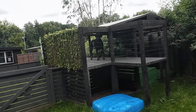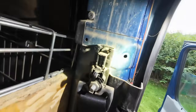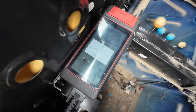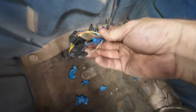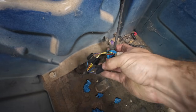Pretty glad there's a cage in the way! But anyway, a couple of bolts up here, one down there, a little plug, and it just bolts in here. It's all back together - just going to get the diagnostic computer on there, see if we can clear the code and it stays off. It has had wiring repairs down here previously which I've checked, and all the connections are good, so I don't think it's that.